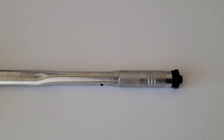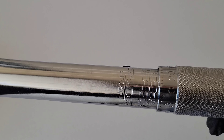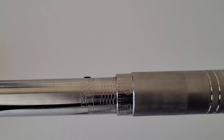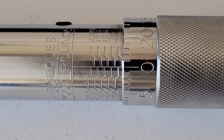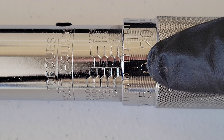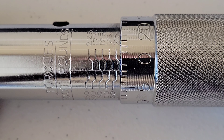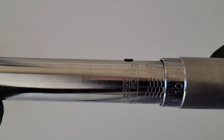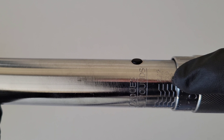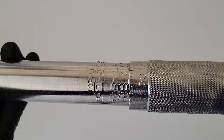Looking at the torque wrench now — here's the newton meter side, here's the foot-pound side, and it's currently set to 25 foot-pounds, which is the lowest setting. This is how you always want to store your torque wrench when not in use. On the scale, the zero line meeting the 25 mark equals 25 foot-pounds, and each notch up is 26, 27, 28 foot-pounds, and so on. The spec for my 2006 Corolla lug nuts is 76 foot-pounds. To adjust, loosen the lock knob and twist up.